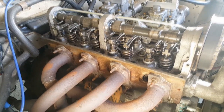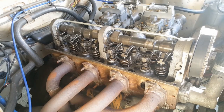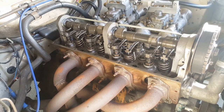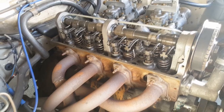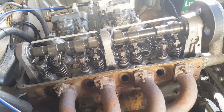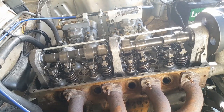Now I'm going to do quite an interesting little thing — prime the oil system. It's sat for ages, all the oil is down in the bottom of the sump, and we just want to make sure it works its way around the engine through the main bearings and up to the camshaft before I try to start the thing. I've got the spark plugs out so the engine will turn over quite freely. I'm going to hit the ignition and turn the engine over until I see oil coming out of this oil spray bar here. There are eight holes in this spray bar — one for each cam lobe — and when oil works its way to the top of the engine, we'll see it squirting down onto the cam lobes. I'm going to hit the ignition key now and we should in five or ten seconds see oil coming out on that spray bar.